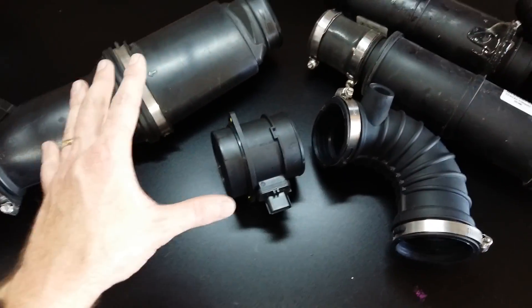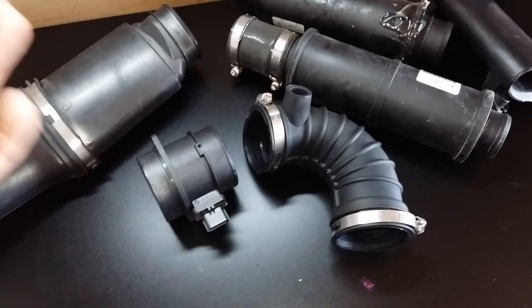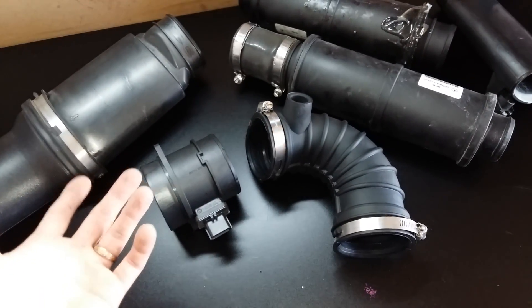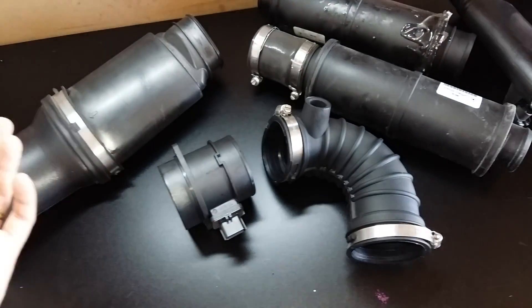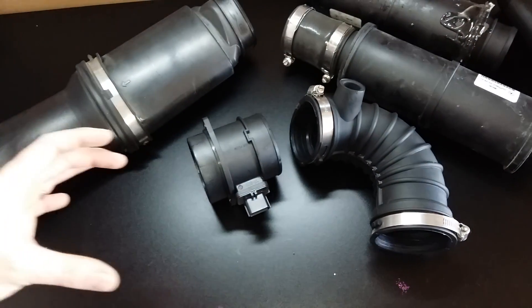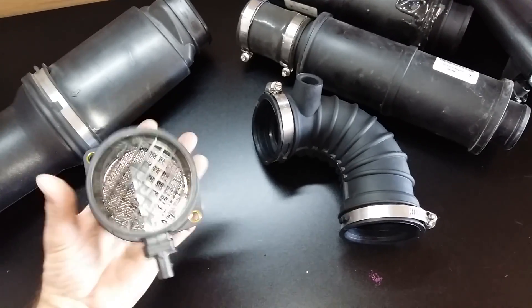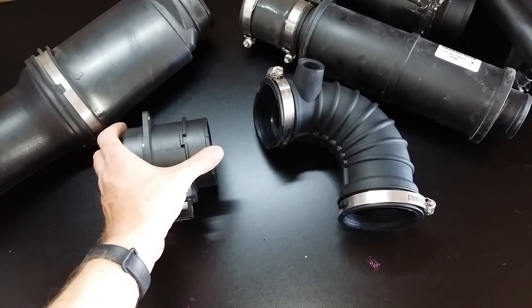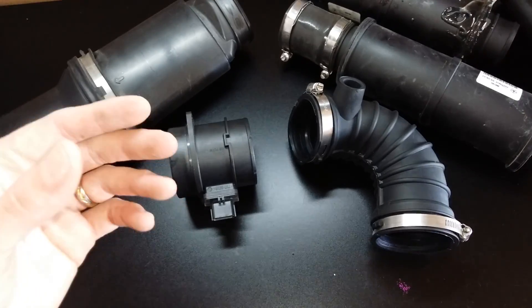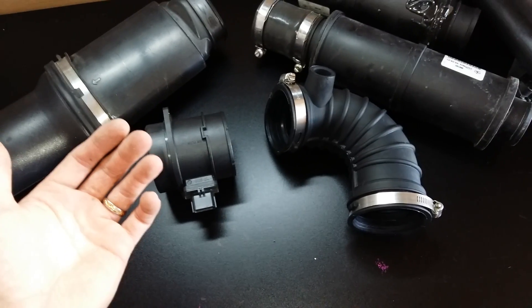What I know about the air boxes you're finding from the OEMs or from aftermarket companies — the AFE air box I think is the most poorly designed. The S&B box is the best design for an aftermarket air box, but I find there's no purpose for changing the air box itself. It's a waste of money because they're all using the same fender air intake tube. You can only flow so much air through an air box and through these hoses. The factory air box on your Dodge Ram EcoDiesel is sufficient — there's no problem with it at all. It flows enough air through its original entrance, and they're all using the same stock OEM air intake tube — it's not an aftermarket one.